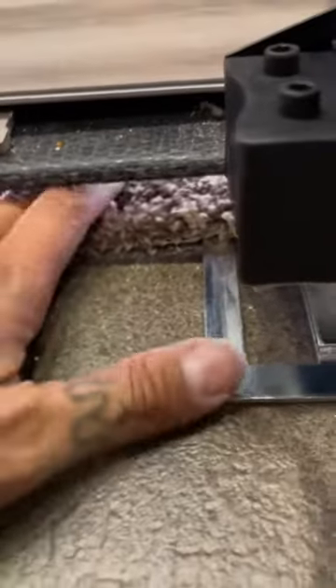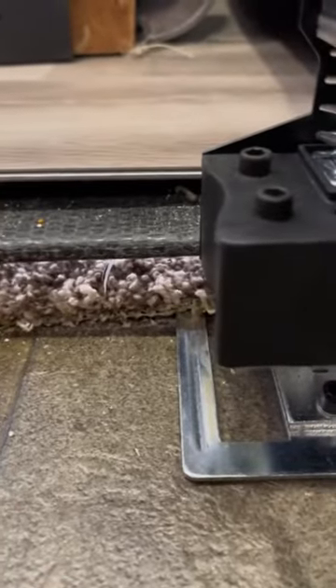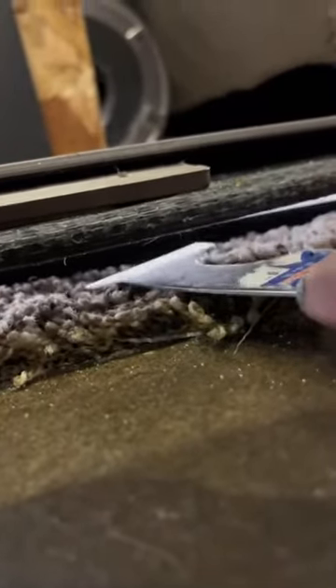You can even see the outside of the slide-out. But here's a little disclaimer: if you look where the carpet is right here, don't try to yank it out, because the carpet is installed underneath this plastic piece right here that helps hold the trimming of the slide-out — this black piece. The carpet is underneath there, so you can't yank the carpet out. Otherwise, you might mess up your trim outside, and you don't want to do that because then that causes a whole bunch of other problems.